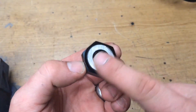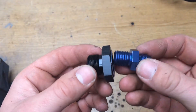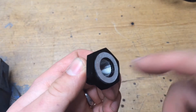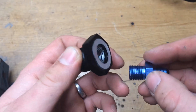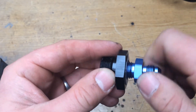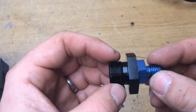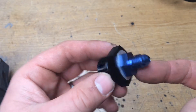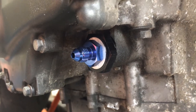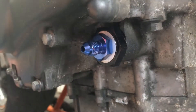The adapter is all finished now — the back is sanded off and filed nice and flat, threaded all the way through and tapped out. It threads in nicely, and I've left a small gap inside so I can slide an o-ring seal up into there. When threaded down with a bit of Loctite, that'll seal up nice and tight. That's the M20 by 1 to AN4 fitting adapter ready to go for the oil supply line to the turbo, and it fits spot on onto the motor. All I have to do now is put a 90-degree bend on here to run the oil feed pipe up to the turbo.